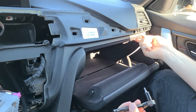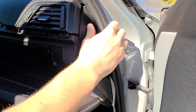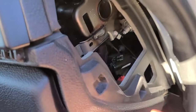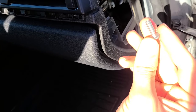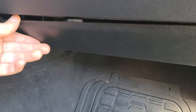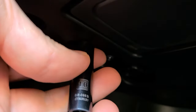First remove the four bolts, then there's one more bolt from the top holding it. That bolt is hidden behind a panel — to get to it, pull down the weather stripping and use the panel removal tool to pop the panel off. With the panel removed you'll see a T20 which looks different from all the others. Now remove the two 10 millimeter nuts under the glove box that hold the plastic tray, using the 10 millimeter socket with an extension.